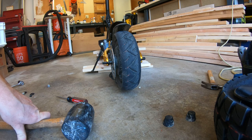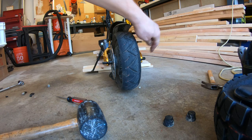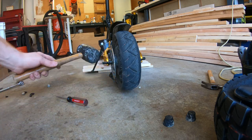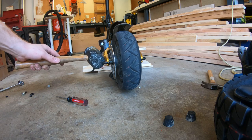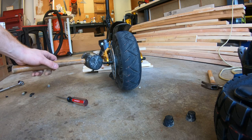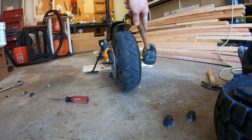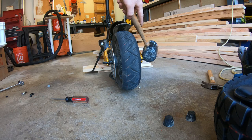If you've been riding your scooter pretty hard, this is gonna be pretty jammed up in the sides of the frame. I've got a rubber mallet here and I'm just gonna hit the axle like that. You don't want to use a regular hammer, because if you damage the threads on this you're not gonna be able to get the axle nuts back on. So I'm just gonna bash the crap out of this until the tire comes off.